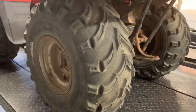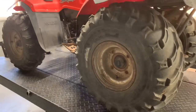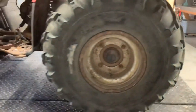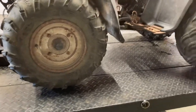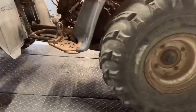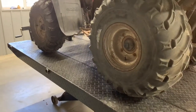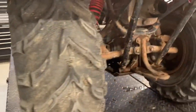You've got 10-inch rims on both the front and rear. The rear tires are substantially larger than the front — rear is a 25-12-10 and front is a 22-8-10. So substantially smaller in height and width, though the rim size is the same. You're not going to interchange the front and rear tires; you just won't have enough clearance.